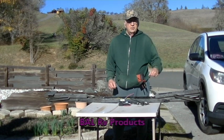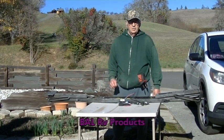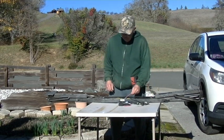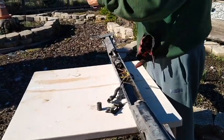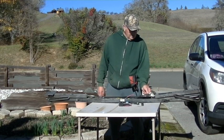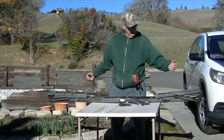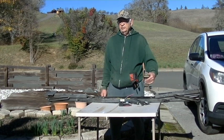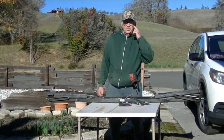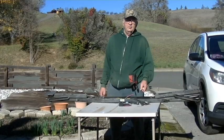I ordered the motor. I got the part number online and ordered it. It took about a week to get here — the part number is in the description below. It's just a matter of taking the cover off and extracting the motor, which is just four screws. If the limiter switch doesn't work once it's all put back together, I do have a replacement part for that, which I also had to order online and find on Amazon.